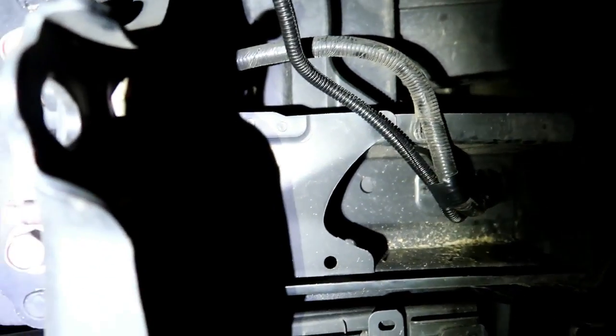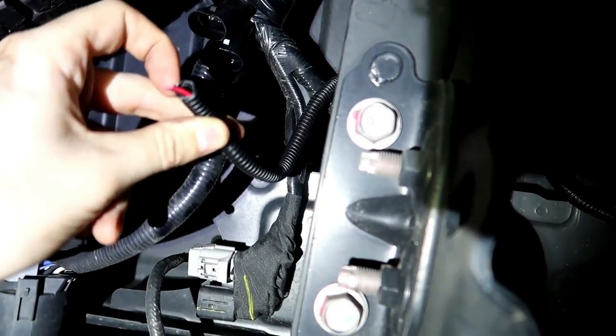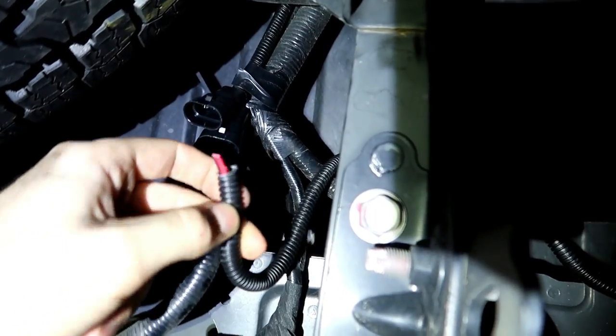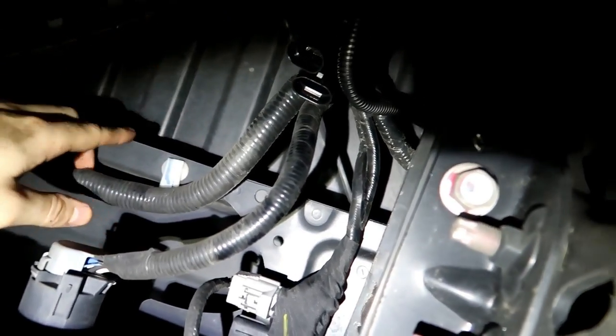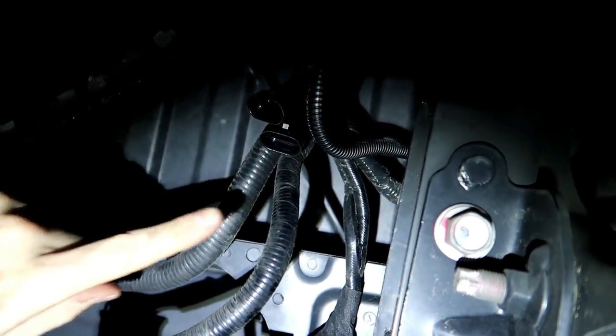Right here I'm going to show you what I did. Basically I ran it down, did one tape here, brought it over and got it to a point where I'm going to plug it in. I cut it off, now I'm going to pull this back around and put those crimp connectors on these two ends so that we can plug it in — all waterproof and nice and tidy. I'm going to do the same thing for the other side. This right here is the main lead heading up to the front of the truck. We'll cut this to length when we get to the front. Also, side note: if your truck's a little bit dirty, wear some safety glasses so that debris does not get in your eyes. Safety first!